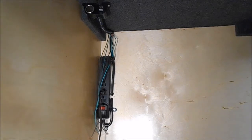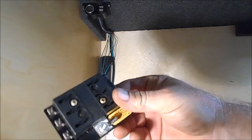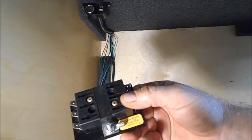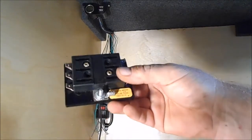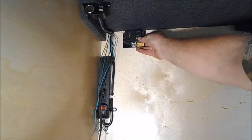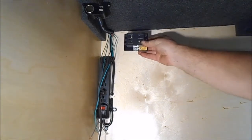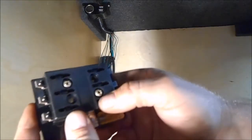With this charger inverter inside the camper, you're going to need some type of fuse box. I went into Advanced Auto and picked up a six-slot fuse panel box - I think it was about ten dollars. I'm going to be mounting it up here in this corner because we have to have fuses on there - we can't do without fuses.